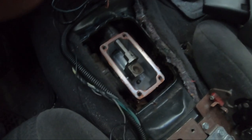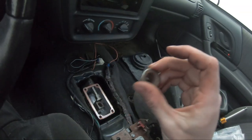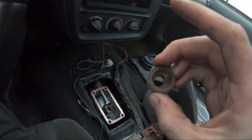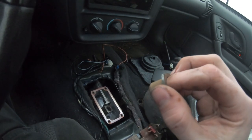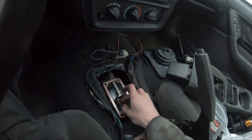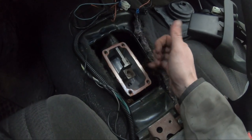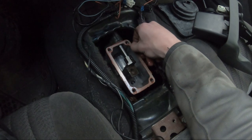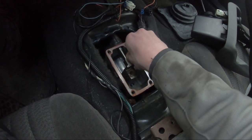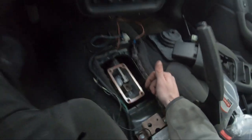So we're going to put some lube on this little thing right here — it's going to go down in there and that'll give us what gear we're in. These actually wear out sometimes, so if you guys are doing this, it's probably a good idea to put a new one in. As you can see, mine's actually cracked right there — it doesn't feel bad other than that little crack on top, but that shouldn't affect it. I know when I got a transmission kit for my other car it came with one, but I didn't need it. So I'm going to get all this RTV off of here and then put mine on.